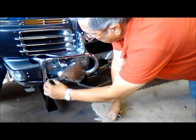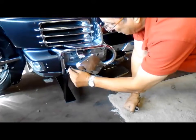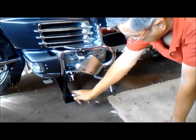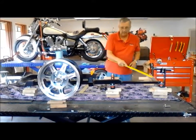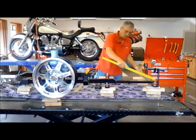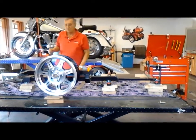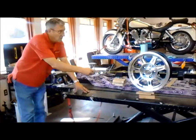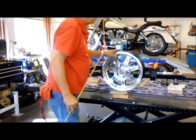If this is bent, one side you might be this far back and the other side you might be a little up this way. But the important part is that it's square. I get a pad and a pen and I make a drawing — this point, this point, that point, and a point out here — and the measurement from here to here. Those are the measurements you need to know.